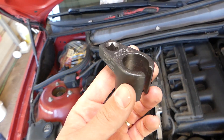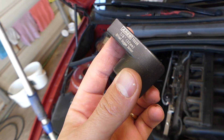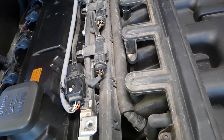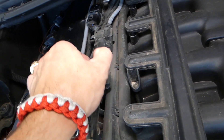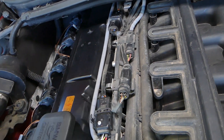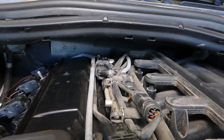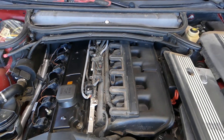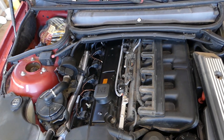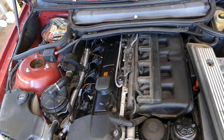All the tools we'll be using — this is the special oxygen sensor socket that makes your work way easier. Check it out listed in the description below. This is the connector we need for P0036 — this is the oxygen sensor right here. You undo it from right here, spread those clips open, and you can pull it out. Follow the wire towards the back — there is a zip tie holding it there, so you may need to install one later so the cables don't get burned. We'll have a full video from start to finish on the channel on how to replace all the oxygen sensors. In today's video, we'll see if replacing that sensor takes care of the problem and that code.